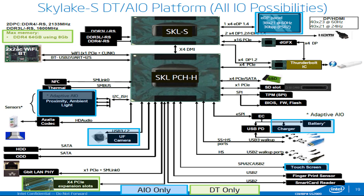Our sources tell us the pre-production Skylake CPU is the i7-6700K: four-core, eight-thread, eight megs of L3 cache. It has massively upgraded Iris Pro graphics and DirectX 12 support. But in terms of raw single-thread and multi-core performance, it's basically on par with Haswell, Sandy Bridge, and Ivy Bridge clock-for-clock — a little faster, but not 20–30% gains. It does have new extra instructions that speed up certain tasks significantly, including integrated support for the VP8, VP9, and HEVC codecs for encoding and decoding, which will be a significant improvement for those workloads.